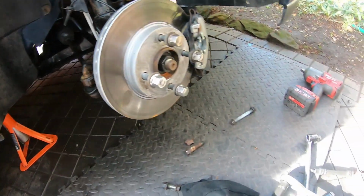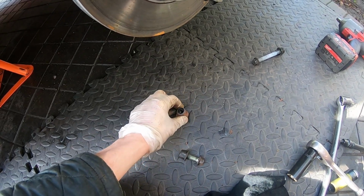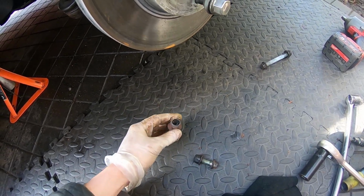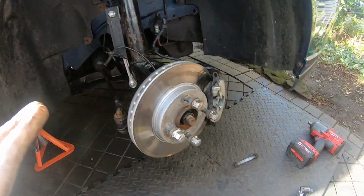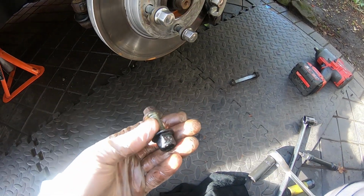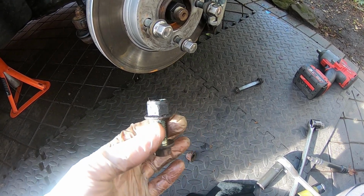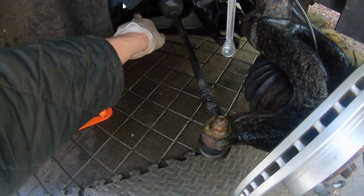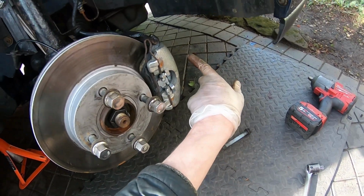But yeah, these bolts. Now, Ford changed in their, there was a vehicle supplement in around 1999 saying that there was complaints from customers regarding knocking noises going over bumps, and it was due to these torque to yield bolts not being torqued up enough. So they suggested tightening them a bit more on the angle. Now, when you torque them up, I think that one's 120, that one's I think 100, 120, and 115 for that front one there.